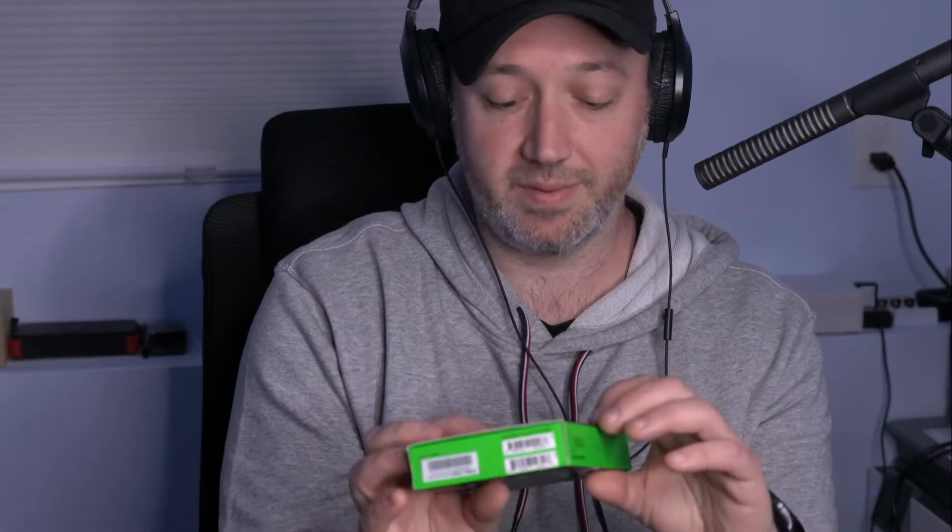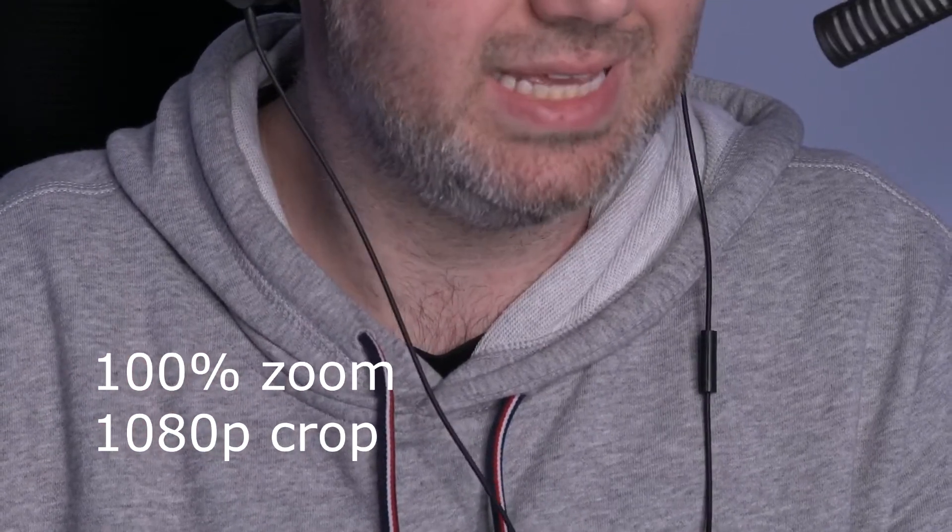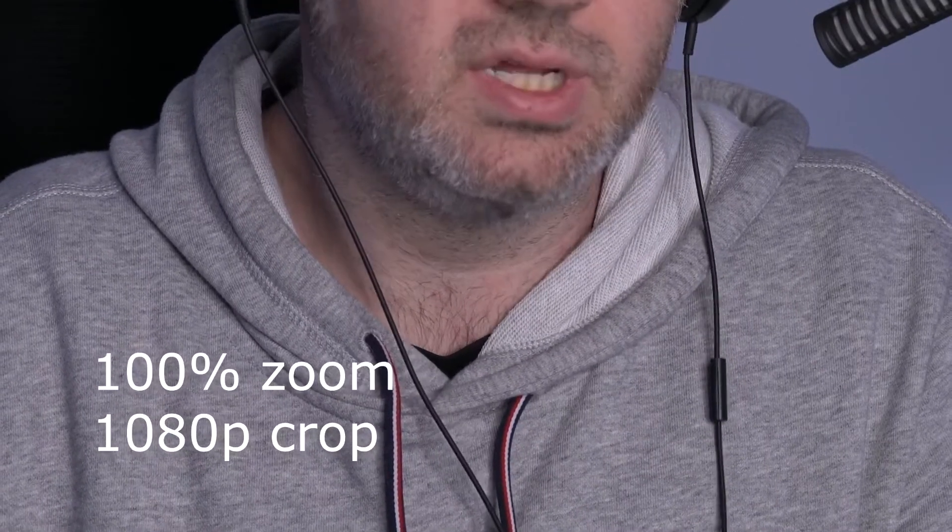I'm actually just using the standard Windows camera app to record this. What's really great about this — Razer is a trusted brand in gaming equipment, so I expected some quality. The fact that it says 4K was pretty cool, because I've had other ones that were supposedly 4K but really just accepted a 4K signal from the camera while the connection to the computer was only 1080p, since sending 4K over USB is a lot of data. But when I plugged this one in, one of the options in my recording settings was 2160p, which is the consumer version of 4K resolution. So this is right now recording in 2160p.